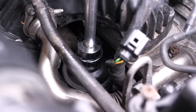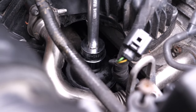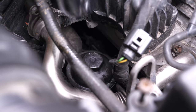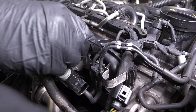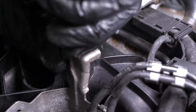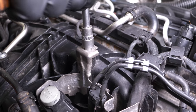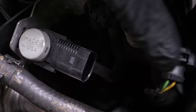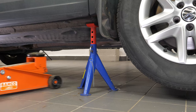With this kind of oil filter, the new joints can be excessively thick, making the tightening process more complicated. As a result, you must ensure that the flange washer is flat against the oil filter housing. For this step, you can also use a torque wrench set to 25 Nm. Screw the retaining bracket back on, reconnect the electric connector, and put the engine cover back on.